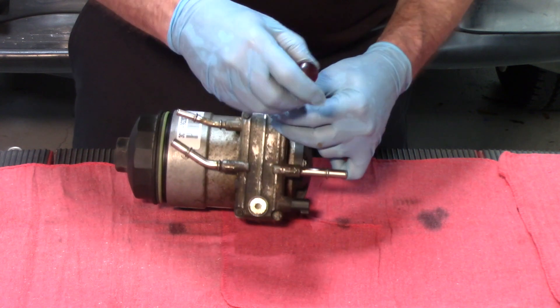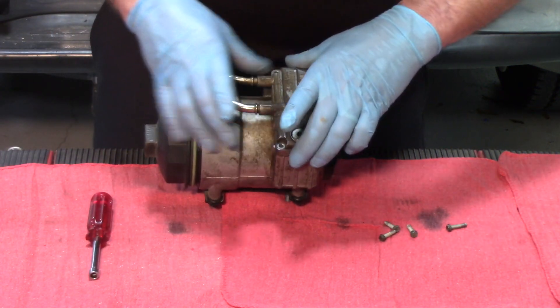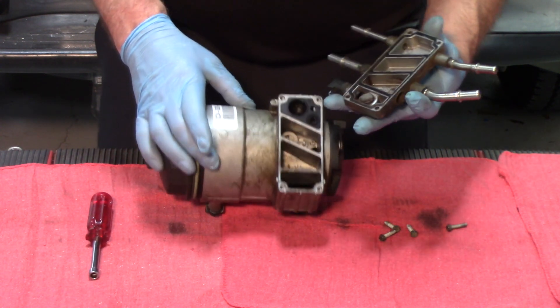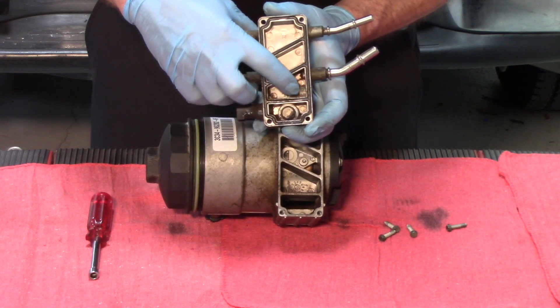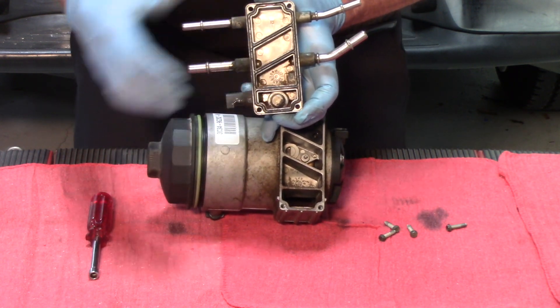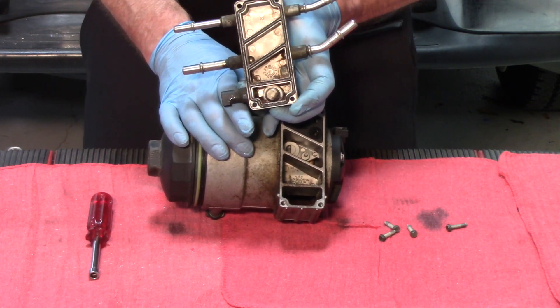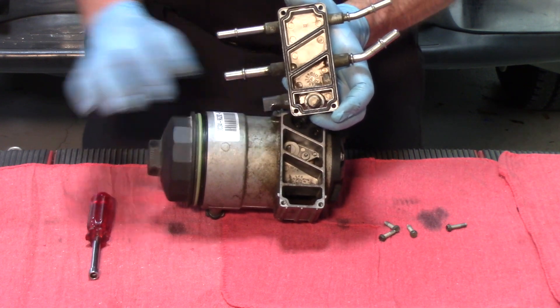Let's take the cover off of this. With the last screw out, let's take a look at the inside of the water trap. As we get a close-up on it, we'll find that there is a tremendous amount of rust build-up inside here — particulate that has collected inside this trap. That's not a good thing; once it leaves here it is headed directly to the engine.